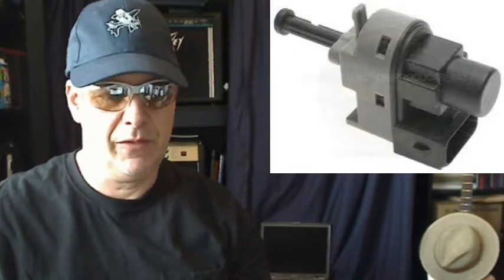My wife's Ford Focus Sport ZX3 has some strange wiring or electrical problems. I went to investigate this and started off by changing the switch underneath the brake — basically a switch that controls the back stoplight, so I think it's called a stoplight switch. I replaced that stoplight switch thinking the problem would go away. The problem was that the cruise control would work sometimes and wouldn't work other times, and my neighbor told me that our stoplights were permanently on, which was strange to me.